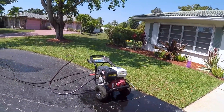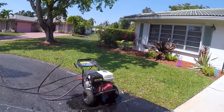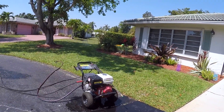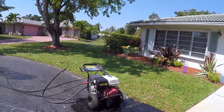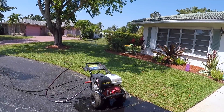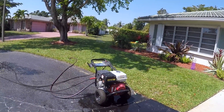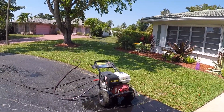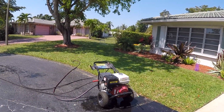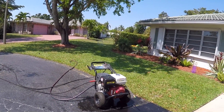Alright, so you can tell the engine shuts off — it's only really working when the choke is on. When the choke is halfway or fully off it starts surging. So what I'm going to do in the next video is go ahead and try to clean the carburetor jet and see if that helps out. Once again, I appreciate you watching — any suggestions or comments, go ahead and leave them. Please subscribe to the channel if this video helped you out.